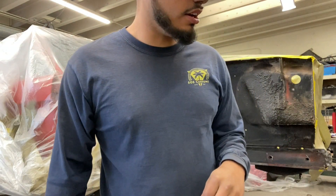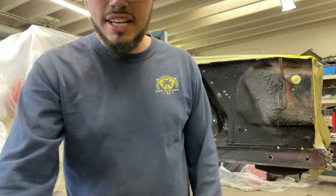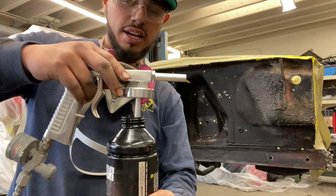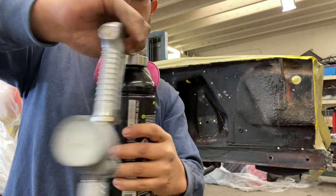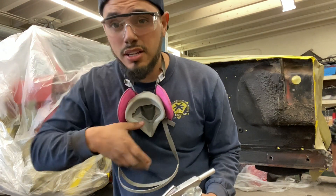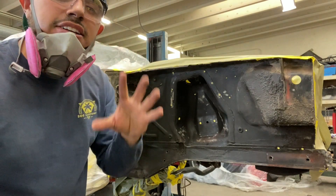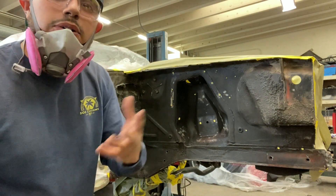Once you've mixed this up thoroughly, you're going to want to get some protection because this stuff gets into your nose, nostrils, and pores. Once it's shaken enough, remove the cap that comes with it, drop it in the box, and put your gun directly in here and screw it on tight — make sure it catches properly. Put your mask on before you start spraying. I'd recommend doing a couple of test panels on some cardboard to see how you want your spray pattern to be. I've done this a couple of times so I know what I'm doing — we're going to start spraying this whole side in light coats and then switch over to the other side.